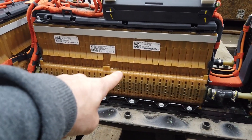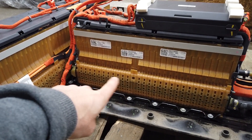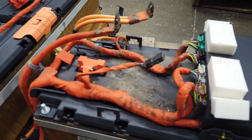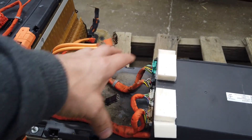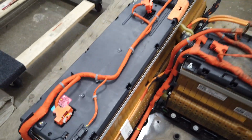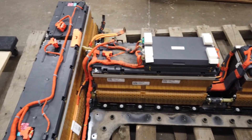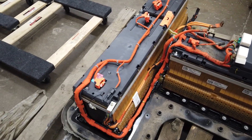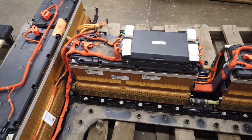Unfortunately, one battery right here is low on voltage - it's not the most healthy. I'm going to try to figure out how to save it. I'm assuming it's because they had the isolation switch out and it was probably stored at the wrecking yard in bad condition. Some of the battery poles are corroded. The car only had 8,000 miles on it, so hopefully the batteries are good and just need to be charged up - they've probably been sitting for years since this is a 2018 VIN.